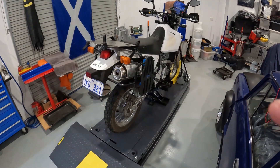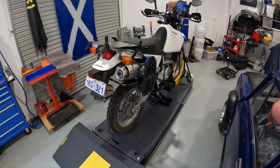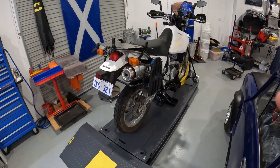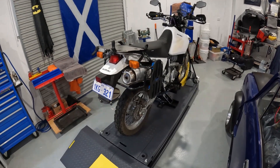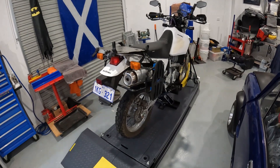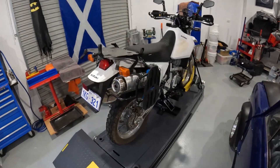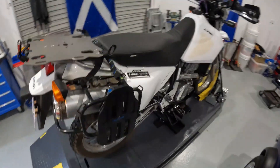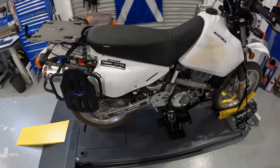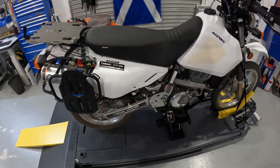The DR is back from its initial service and back on the bike lift. The shocks feel not bad, but previous videos have shown why they are too soft - the calculation shows they're too soft as well. There's just too much sag and you can't use preload. So I'm going to whip out the shock, take off the spring, and send it away to get revalved and resprung.